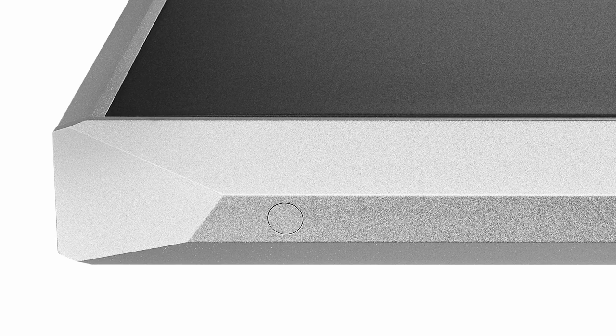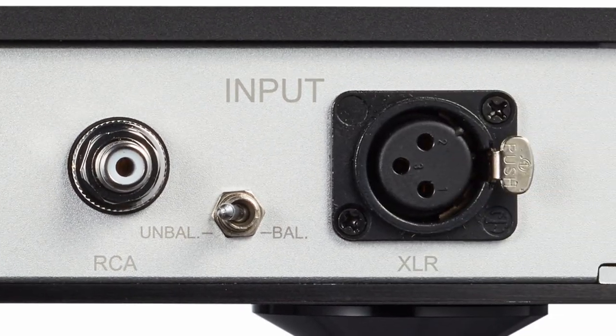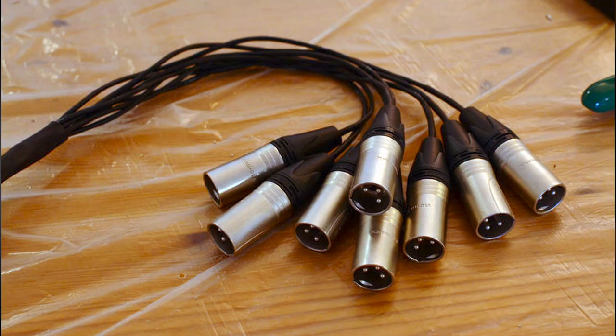There's a little discrete relay power button to the left that you push and hold to turn on and off. In the back we'll find the power input, some decent speaker terminals that accept banana plugs, and the choice of balanced or unbalanced line inputs. To keep the signal path as transparent and noise-free as possible, I would always recommend using balanced signals if the connecting equipment has it. Balanced signals also have the advantage that cables can be much longer without any subjective loss of quality — this is also what is used throughout studios and at concerts.